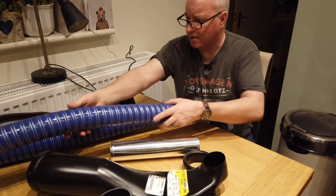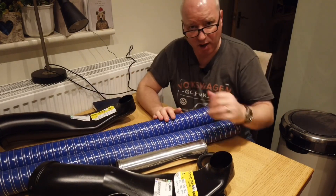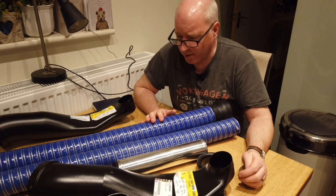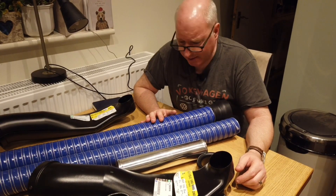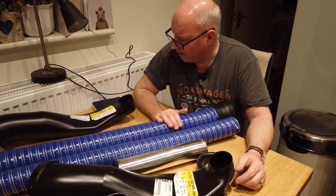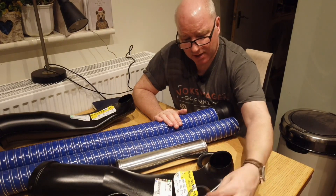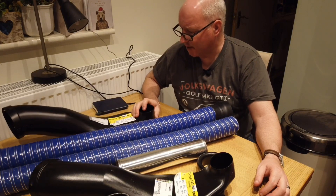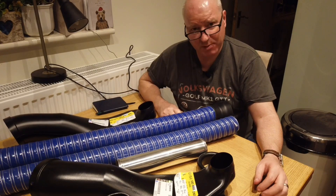The whole reason for this is that the cooler you keep your brakes, the better performance you get out of them. But more importantly, they last longer. And if you're building an endurance racer, something that's going to be hard on the brakes in general, it's the only way to do it. The key of course is these Corvette intakes, which none of the other guys will tell you. I've even listed the part numbers on the website as well to help you out.